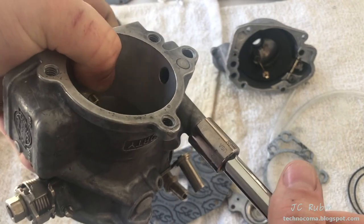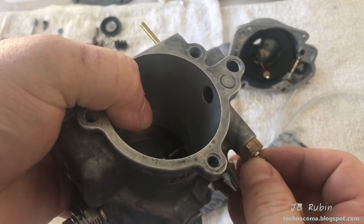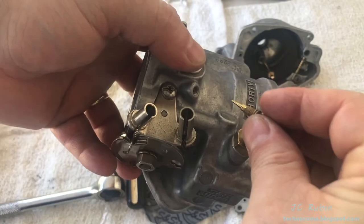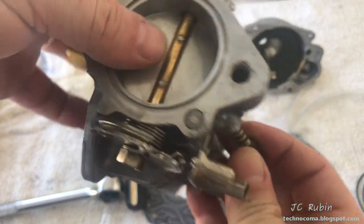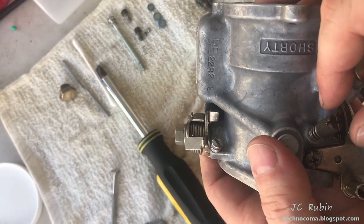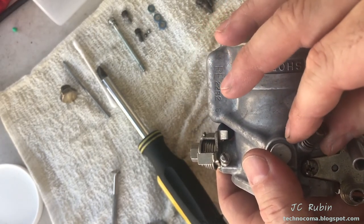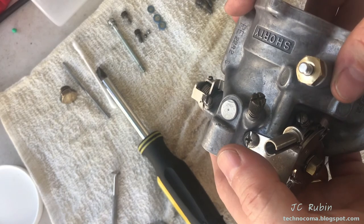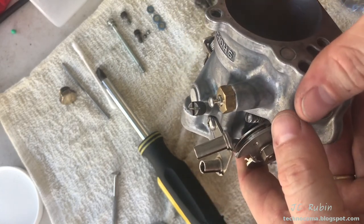Drop the half-inch on top of it and give it a gentle tighten — that's it. I'll test it — no binding, snaps back shut. Just check that it springs back nicely. Bring the needle back in to full seat. Checking from under to make sure I don't feel any binding. Now I'm going to bring it out one and a quarter turns — that's one and a quarter, and then back to the second line. That's where it originally was before disassembly. It's worth pointing out that after cleaning the carb like this there's a good chance I'll need to readjust this needle once it's back in the bike, but this is a good starting point.